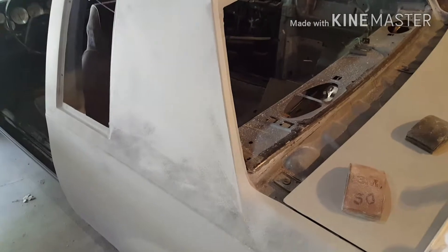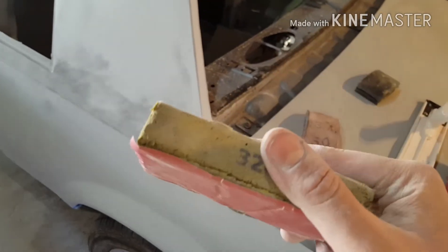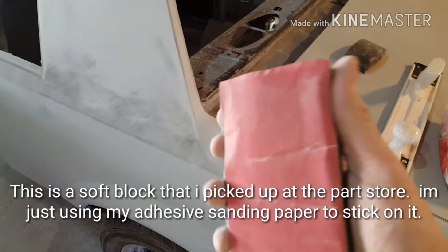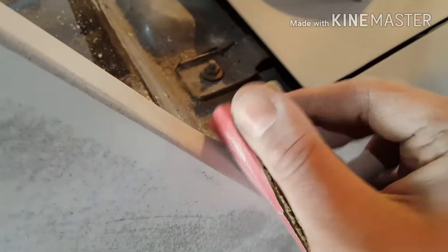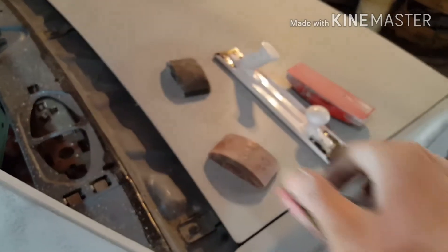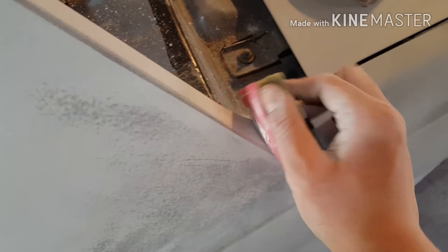All right, another part of my bodywork tip video. Coming to this area, it's really squishy with a lot of swooping lines. I took my soft block - it used to have 320-grit sandpaper - and I'm making a round edge to it, rounding them out. You can fold it and take this part of the block and just kind of roll it. You don't want to go straight down - you want to kind of roll it side to side, and you cross-sand it, same as with everything else you sand.